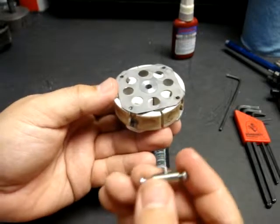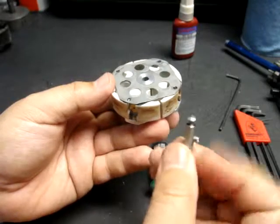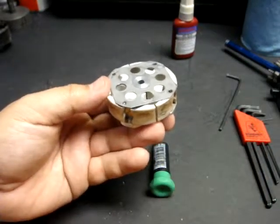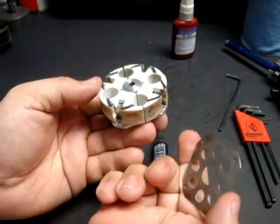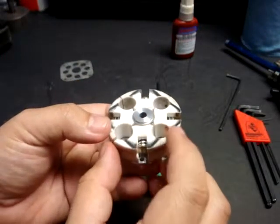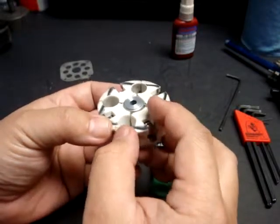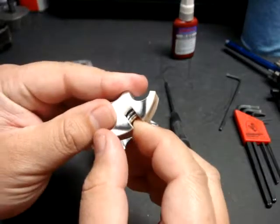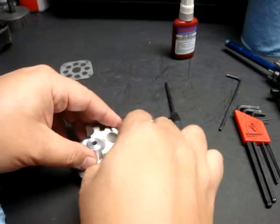Alright, I have removed all four of these posts. I've just put the screws on rather loosely and the adjusting grub nut loosely in here. With all four posts taken off, this thin plate comes off just like that. Now you have your shoes that you can simply pull apart. The shoes just simply slide off straight out. Watch out, because the spring and the brass button could actually come out if you're not careful. They all simply pop off just like that.